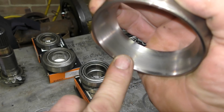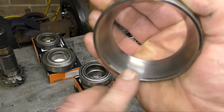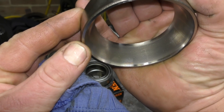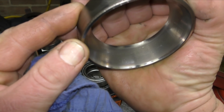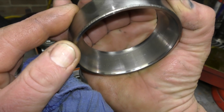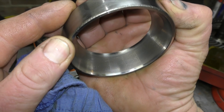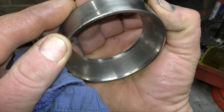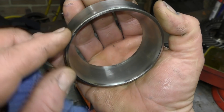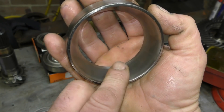This could certainly be exposed to high impact loads. Not only is that through vibrations, but it's also the operation of the diff — speeding up, slowing down. If you look very slowly, you'll be able to see it's not scallops but it has lines in it. You see those lines there? It's not the lighting in the studio — it's actually on the bearing race itself. It's had a fairly hard life, this diff. It's survived.